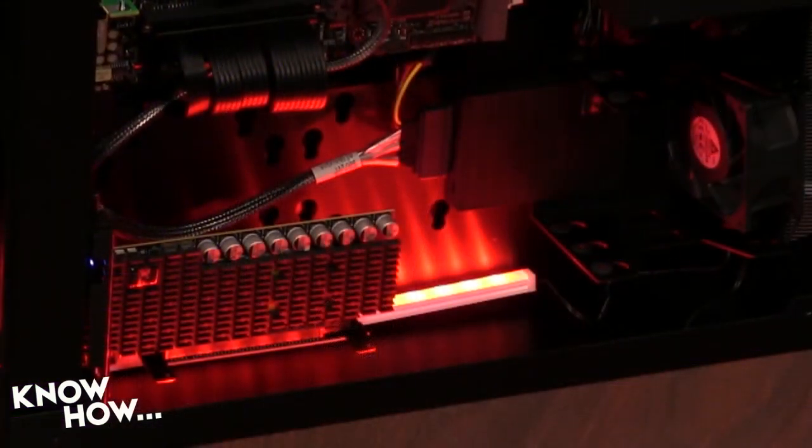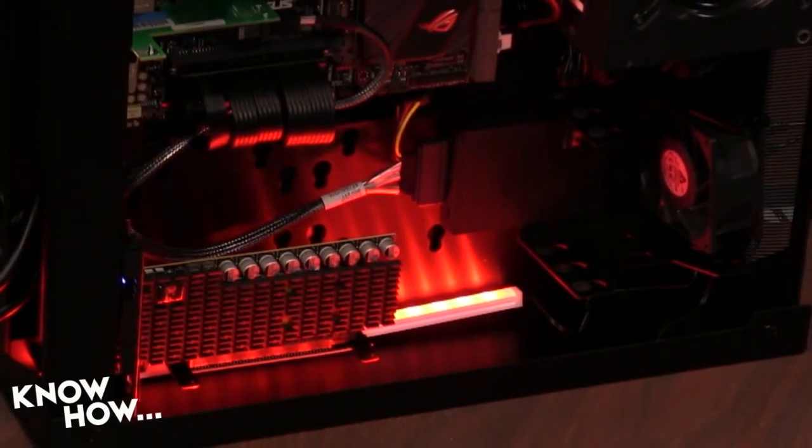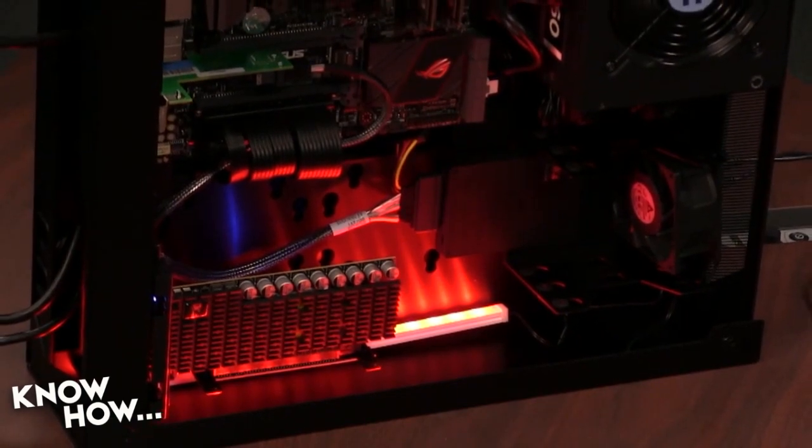So a couple things. We need the PCIe switch just for what you said. We're running out of PCIe lanes. So for NVMe-based storage, switching technology is a reality. We've brought it to the half-height, half-length card to aggregate physical drives behind the switch to a single PCIe connection. We don't lose anything with the switch because we're doing all the switching in hardware. We're not doing it in software. So there really is a minor penalty in terms of latency and throughput by attaching through a switch. I would say the benefits far outweigh the cons here.